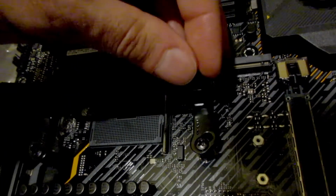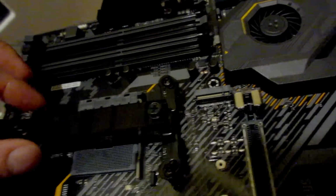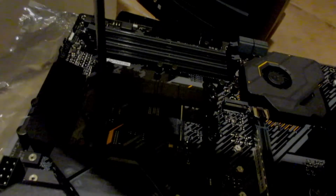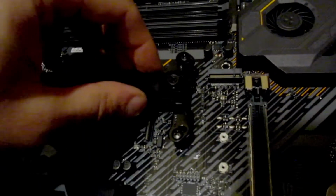Like I thought, to make your life easier, being that these are slotted, your holes might not line up perfectly. So you have to loosen these two screws, those two screws, test the bracket with the two included mounting screws, and make sure you can tighten it with no interference. And then you can move these things around. That's good right there. Before I was too far out and the screw holes were blocking. So just keep that in mind. Test fit it with the crossbar, then tighten the 4 screws with the AMD, and should be good. Yeah, that should be fine.